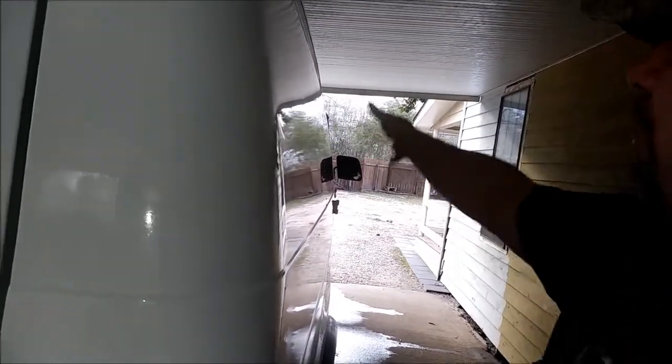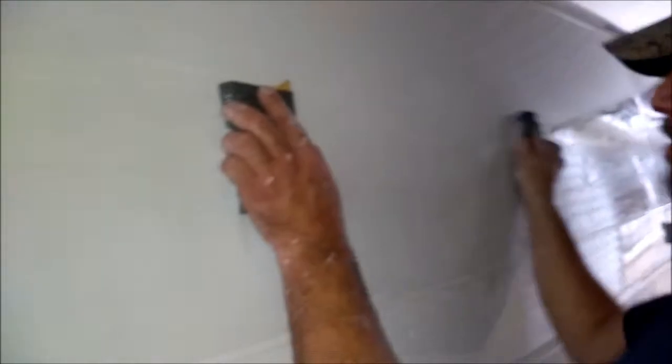You can tell we've got a lot of sanding left to go. I'm going to get someone with more energy than me to sand this, or we're going to get a DA sander. The 3M 1200 grit swirl marks from the sandpaper were taken down with that DA at 1200 grit — you didn't have to jump to 2000 and above. You could stick with 1200 on a white vehicle. For this big white refrigerator, this is acceptable, but I need to bring this down more to eliminate these clear coat variations. I put four layers of paint on this thing so I can go down deeper to get this orange peel off.